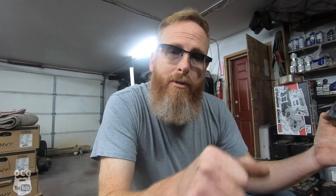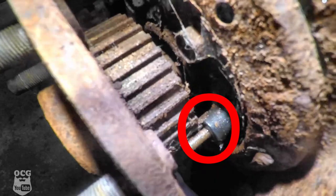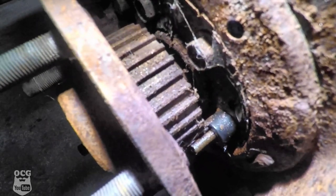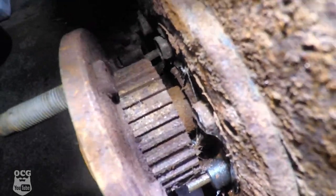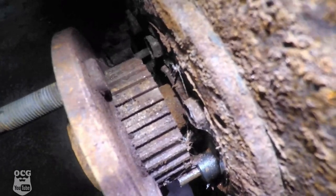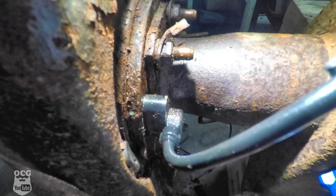We figured out what was going wrong with the axles not being able to push them in all the way. If you can see right down there where the ABS sensor comes out against that reluctor ring — the axle is hitting up against that at the reluctor ring so I can't push it in. There's probably at least a quarter of an inch of travel, which isn't very much but it's enough to get that C-clip out from inside the differential. We've sprayed it down on both sides with WD-40 and we're trying to wiggle out the ABS sensor.